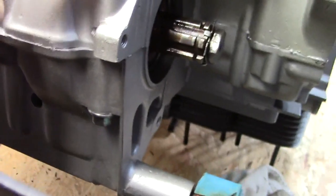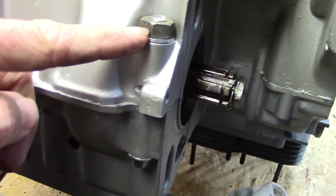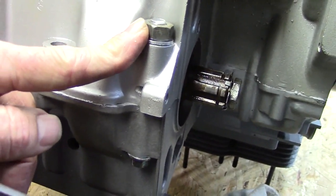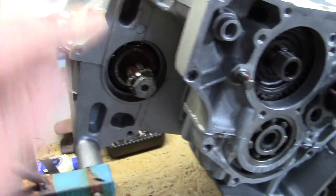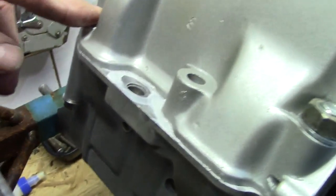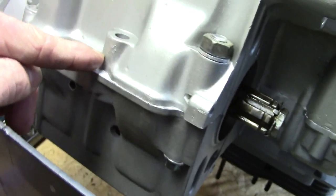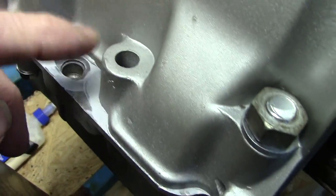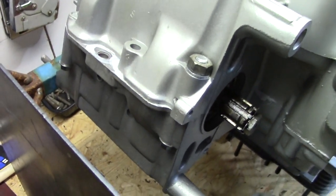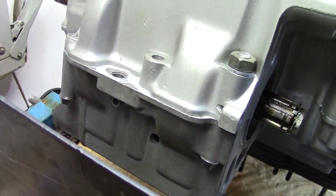I've already done these. This one is a 10 millimeter bolt — it has a nut on this end and comes in through that side. I didn't see a torque spec on that, but it's a little bigger bolt so I went ahead and took that to 25 foot pounds. That's here where the final drive is, so that's a pretty critical bolt with a lot of stress going on right in that area. Over here on this side is another eight millimeter, and that one I took to 18 foot pounds. There's supposed to be one here that according to my chart is an eight millimeter, but the hole is a 10. So I'm going to do a little research on that. Any of you out there that have rebuilt a CB750 K3 1973 and know exactly what the deal is with that bolt — give me a heads up in the comments.